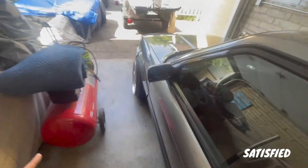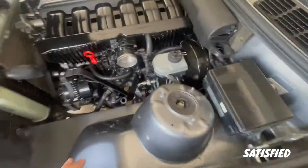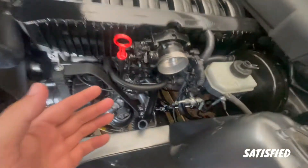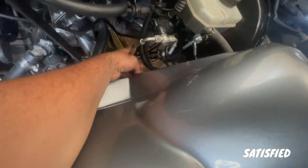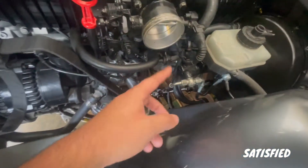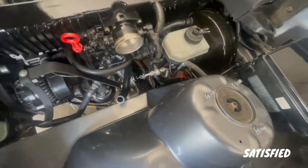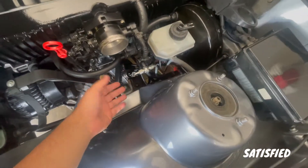We're gonna be continuing this video a week later. I got the whole steering shaft in from Condor Speed Shop — I lost most of the footage while I installed it, unfortunately. But I just want to give you guys an update on how it looks. I got everything removed that I did before and the steering shaft is in. Installing this by myself didn't take too long — took me about 25 minutes. The only tricky part was the top part of the ball joint where it meets the steering shaft. But overall everything went super smoothly. All the space I have now is just very open, so all my brake lines and wiring tucked under the manifold won't get tangled because now that the steering shaft is a lot smaller I have more room.